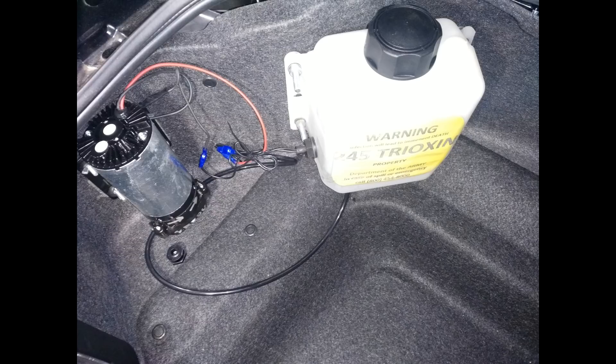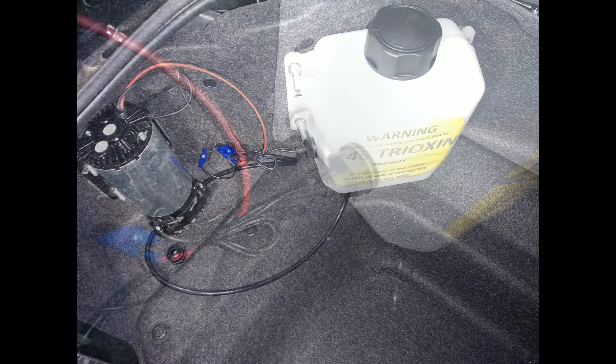Normally I run water, but sometimes I'll run water methanol. Optionally, it's possible to run pure methanol, although for that I would want braided stainless steel lines for extra safety because methanol is flammable. I should mention that some people mix in nitromethane with the water and methanol, but that's a little bit outside the scope of what I want to talk about. At the bottom of the tank is an outlet with a built-in filter, and mounted down low on the side of the tank, you can see we have a low-level sensor.